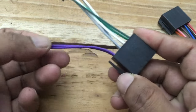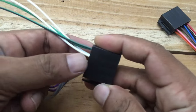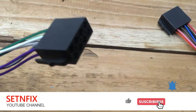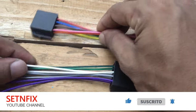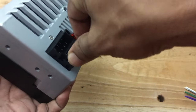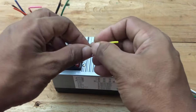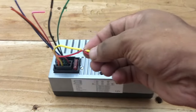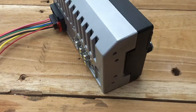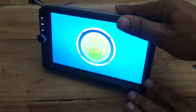The audio cable has 8 wires. You have to connect two of them with the front left side speaker and two with the front right side speaker. Accordingly, you can connect two wires with the rear left side speakers and two with the rear right side speakers. Now shall we power on this device? In order to power on the device, you have to connect both the battery and ignition wire together. But when you install it in the car, you must connect the battery wire to the battery and the ignition wire to the car ignition wire. Now connect the black wire to the ground.